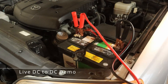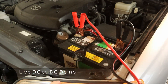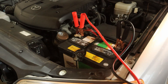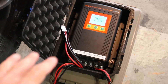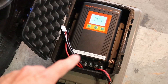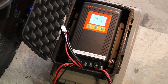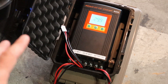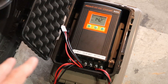Excuse the engine noise, but I have my jumper cables connected to my starter battery — this is a way you basically charge off any battery using this charger. We're getting a full 30 amps. This charger is completely adjustable — I can set it to 10, 15, 20, 25, 30, 45, or 50 amps, and it is pulling 30 amps out of that battery. You might want to go with 20 just to be a little bit safer on your alternator. 20 is quite a bit of charging.